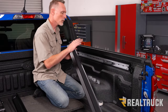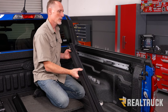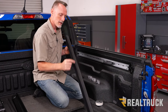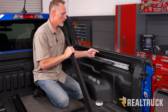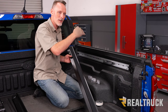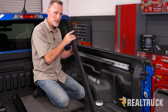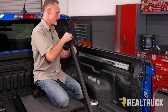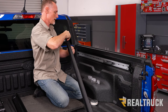The cover we're going to be installing is the TruXedo Pro X15. Some covers you can get away with just installing the rail and clamping it down. Other covers have seals on the inside that are too thick — combined with the thickness of the T-slot rail extrusion, things won't close properly. So I'm going to show you how to remove the existing seal and replace it with a very thin seal that comes in your kit. Just peel it off slowly.